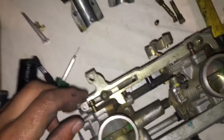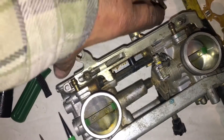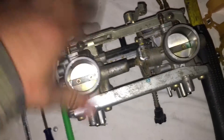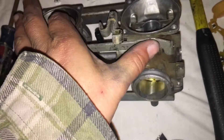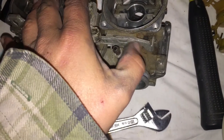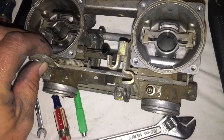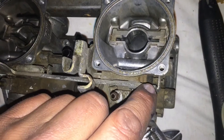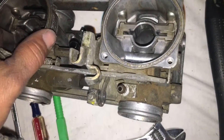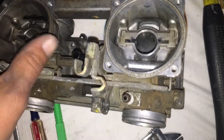I'm also going to have to pull out the choke slides because they are very sticky too. I'll pull off this slide and take these two screws out right here that they slide on. Be careful — there's a nylon washer there that's supposed to let it move easily, so I don't want to lose that. This pulls on the slide, and that is your choke, which lets extra gasoline in when you open it.